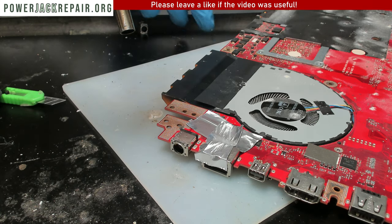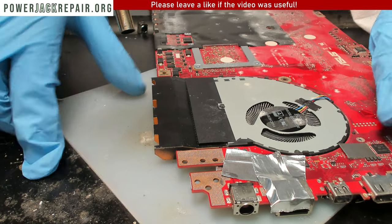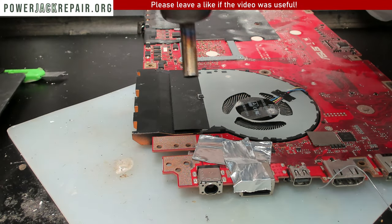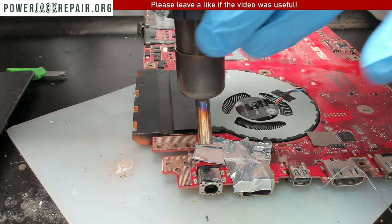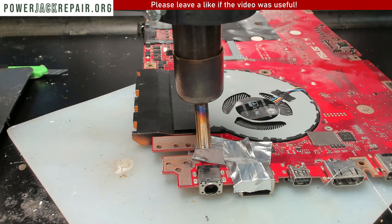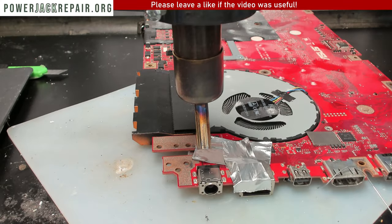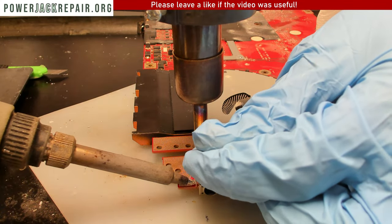All right, so the way this is going to work is this. We're going to put this silicone pad underneath right here. We're going to direct the hot air flow at the back of the connector. That's too far out. That's proper. Let's start at the low heat setting. Warm up the motherboard. At the same time, we're going to add a little bit more solder to the connections.